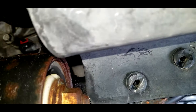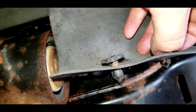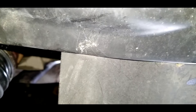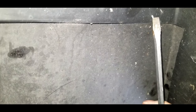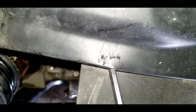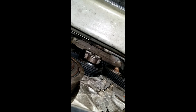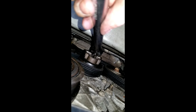That one came out pretty easy — pull it out and remove the retainer. Take off this staple and take off this staple. Pry it open with a flathead, starting from this end and working your way down. You need a breaker bar to release the belt tension. Insert the drive into the belt tensioner, then push the breaker bar to the left to loosen up the belt.